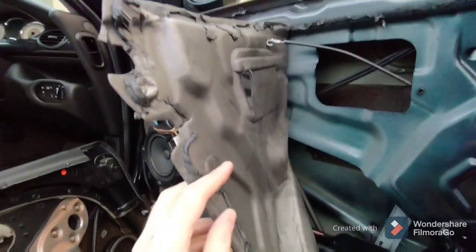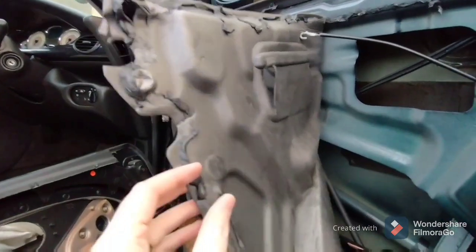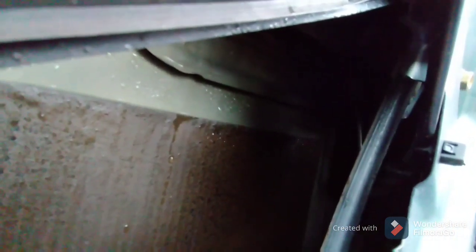That's the membrane peeled back. I think somebody's been here before me — this sealant is actually really sticky, almost like plasticine, so I'm hoping I can just stick it back down. If you look inside here, that is absolutely soaking wet in there. That's the mechanism all up in there, so let's get that dried off and sprayed with some silicone grease.